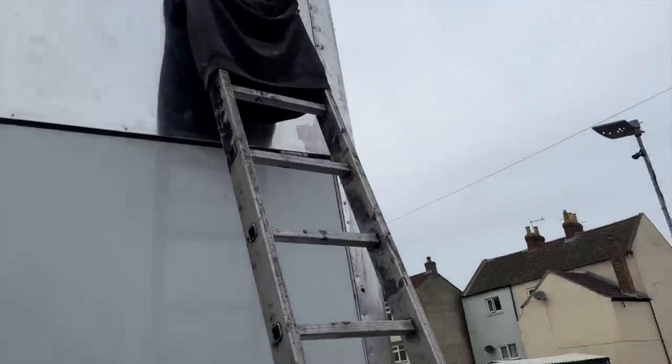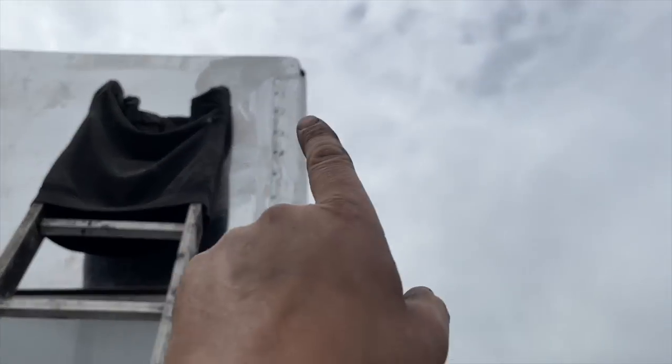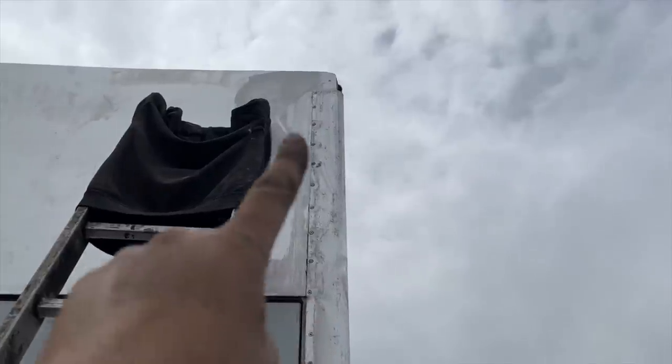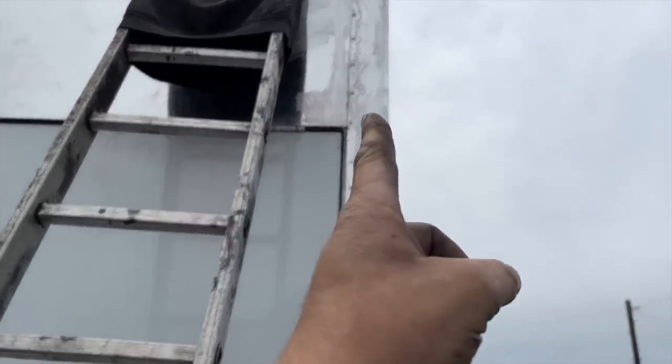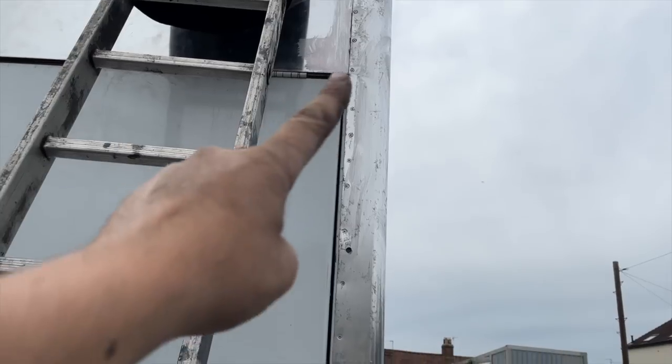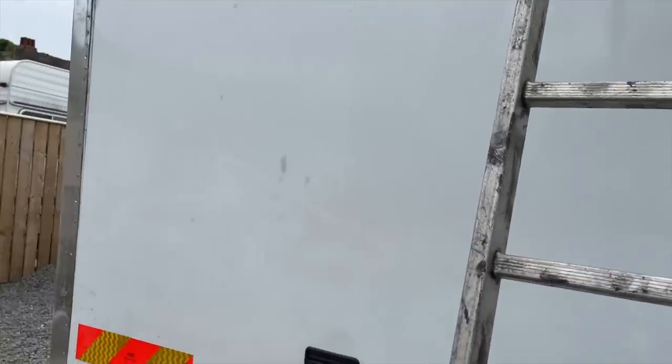Right, they're all pinned back, that side's gluing. That side we did yesterday when John was here. So I've just ground off the tops of the heads now. I'm gonna just put some filler down, just in this top bit. I'm not gonna do this bit yet because I want to straighten up the line so we can put a nice bead of sealer down there, exactly the same as the other.